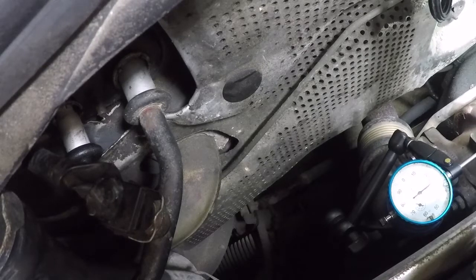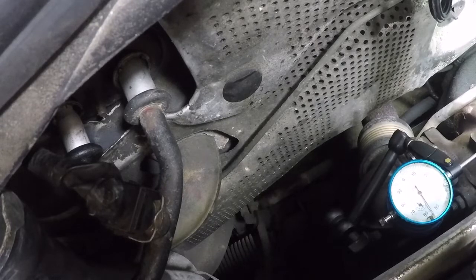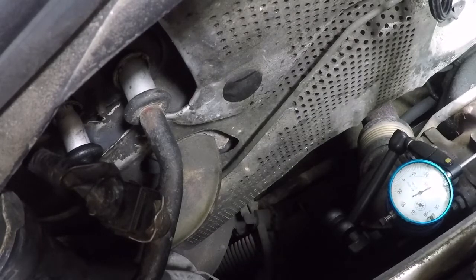That's probably full two, maybe three PSI. This thing is well open — it's leaking past it. If I go up to about four PSI, this thing's well open. We've got about 55, 56 thousandths right there. Watch when I release it — that's more than just a little bit. Apply pressure to it again, and it starts to be about three and a half, four PSI, which is currently what I'm getting under boost. My boost actuator is working, everything's fine, and I'm still only getting about three or four pounds of boost.